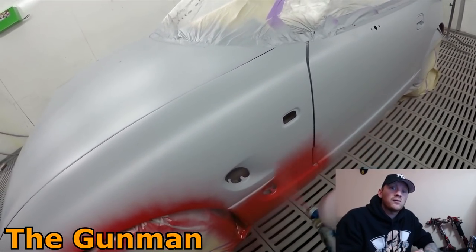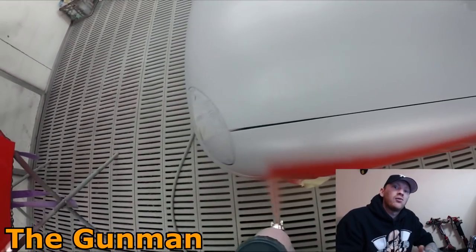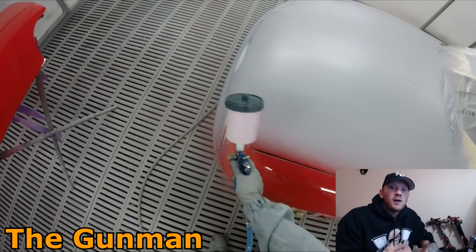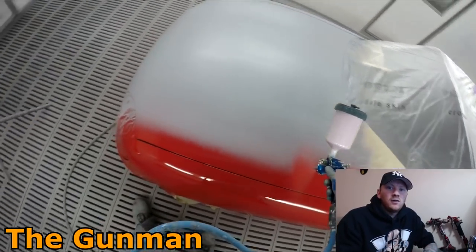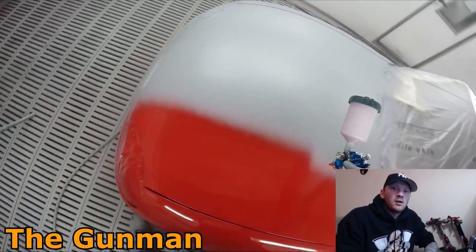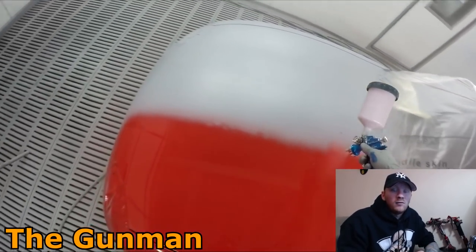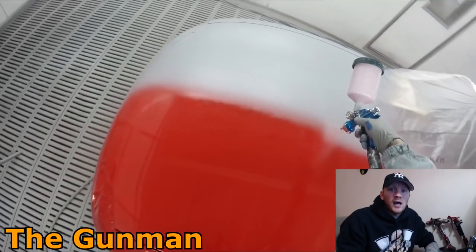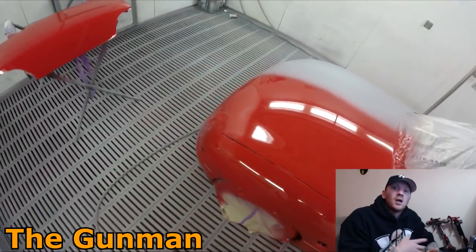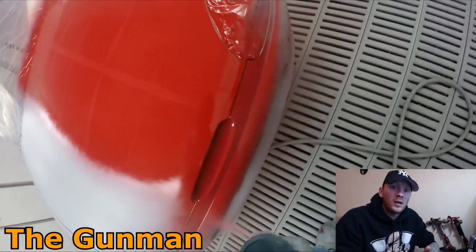With insides and panels, most of the time you can usually just put one and a half coats on over a ground coat. That's another thing that will impact the amount of paint you're going to need for your car. Where I work, we've got lots of old paint sitting on the benches. So if I'm painting red — and I know reds don't cover very well — I've got a couple of options: I can either use a sealer, so a wet-on-wet primer, or I can just find some old red on the bench, put that down first, and that will mean I'm not going to have to use so much colour.